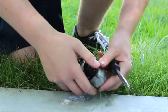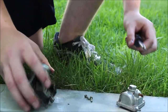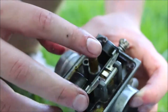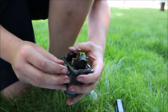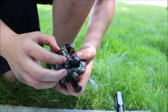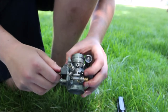It's pissing — John made it squirt. The screws fell out anyway. Let's make sure we don't lose these four screws. These are the floats. You got your jets, you got your main jet right here. You know, the carb is what sets your fuel and air mixture. It's very important that these are set properly, otherwise you're not going to have a smooth idle and your bike isn't going to run right. It won't even rev up if your shit's messed up.